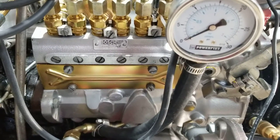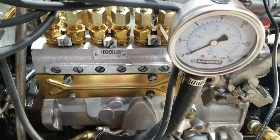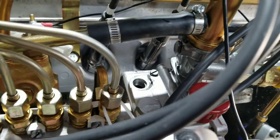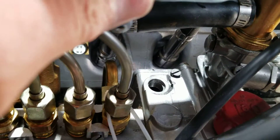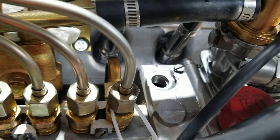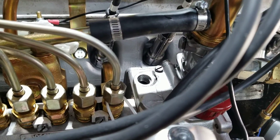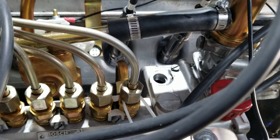There's plenty of information on it by Joe Alexander, Dr. Benz, and a few others. The easiest way - and I have to agree with them - is to just add or subtract shims from underneath the barometric compensator, which normally goes here. I removed it, and I will have another short video just on that subject because I found some interesting stuff I'd like to point out.